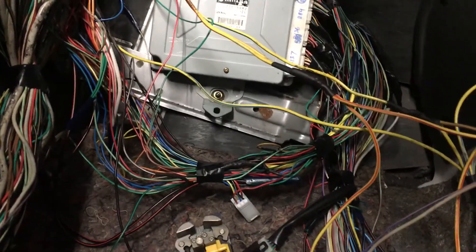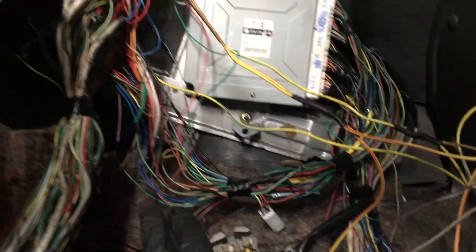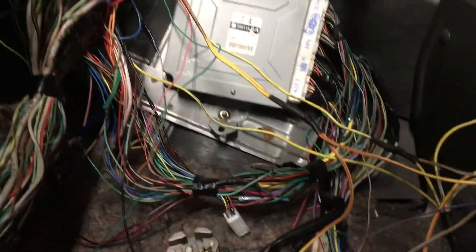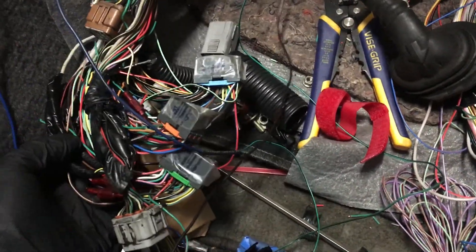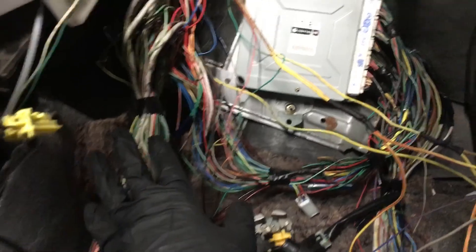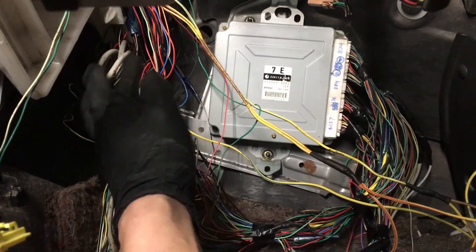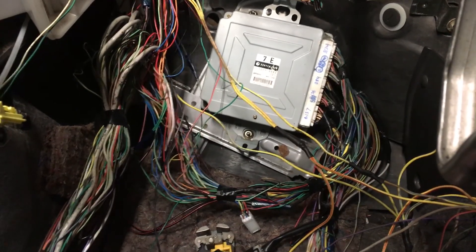I was kind of eyeballing all this and the lengths are not what I want. I have this section that goes to the SMJ and then this goes back to the GC8 harness and you can just see the lengths are a total mess. I'm going to re-cut them and re-solder them so that they're equal. Then there's all this mess here - this is the rest of the GC8 ECU plugs and the ones that went to the engine, and they're intertangled. Instead of just cutting this to remove it, I want to preserve these in case I want to use them in the future.